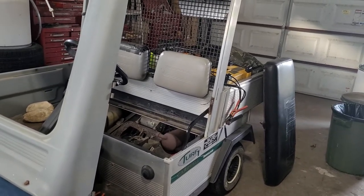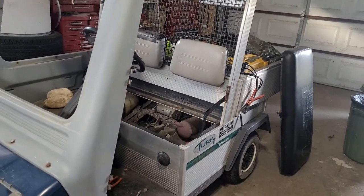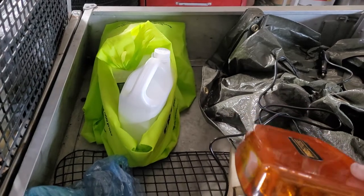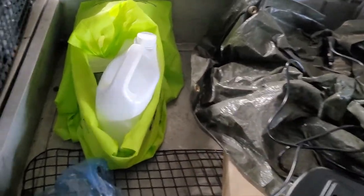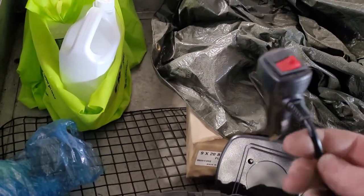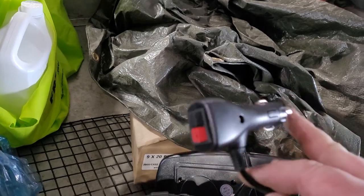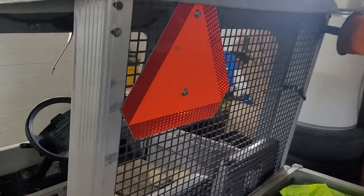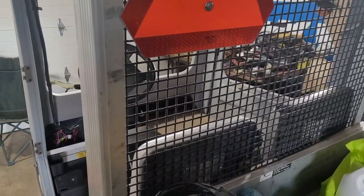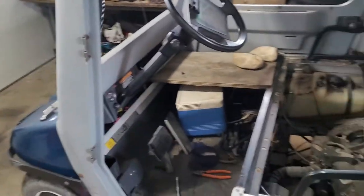That's just an update on what I am currently doing to this machine and what I was actually going to do in the future. Some things will still be done, but other things won't be. I'm almost done with what I want to do to this machine, except for the radio. The rooftop light - almost forgot about that - here it is right here. This is what I'm going for with the rooftop light. This actually has 12 different settings. It is magnetic. I'm going to mount this to the roof, and on the end it has a cigarette-style hookup. This will be connected pretty much straight to the battery - I've got an adapter coming that will be connected to the battery and this will be put in line. I'm going to glue it to the actual roof itself, and when the wire comes out and down I'll just zip tie it to the actual back rack and be done with it. The existing light will be taken off and used on something else.